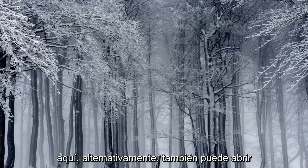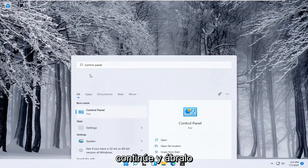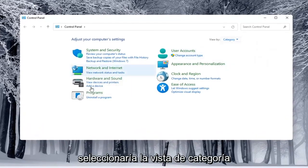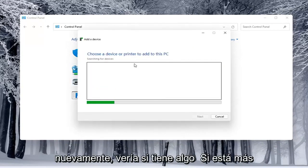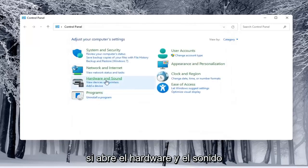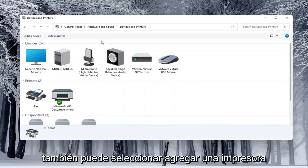Alternatively, you can also open up the Start menu and type in Control Panel. Go ahead and open that up. Select View By and choose Category view. Underneath Hardware and Sound, select Add a Device. You'd see if anything is connected to the computer and walk through those steps. You can also open Hardware and Sound, select Devices and Printers, and then select Add a Printer as well.